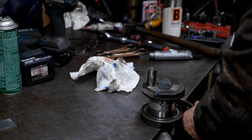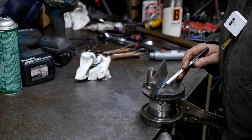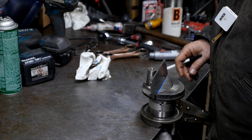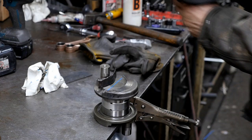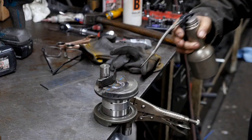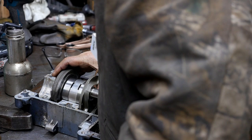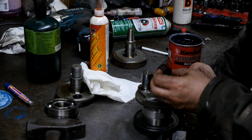The way we check it is by laying a parallel across there — you can see the gaps on this side and that end. This little gap right here and this little gap right here are exactly the same. If it was out of whack it'd be really narrow on one side and wider on the other. That thing is like perfect. We're going to go ahead and weld it.